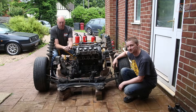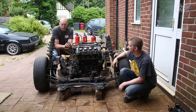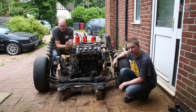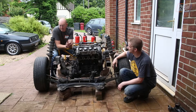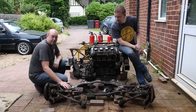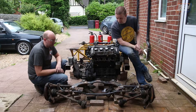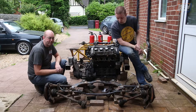So we got to thinking. The A3 Quattro and the TT and the 4Motion Golfs all have trailing arms that mount just in front of underneath where our chassis leg is, and would probably fit. We did a lot of Googling to check drive shaft sizes for splines and various other bits, and they should work. So we went and bought one. So this is the solution — we have trailing arms, a centre subframe where a diff would normally go for the all-wheel drive, and it's a lot more convenient in a lot of ways. And in so many other ways, more of a pain. Total pain.